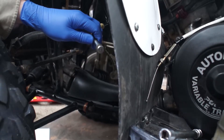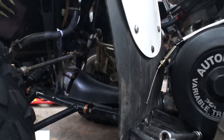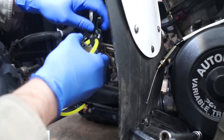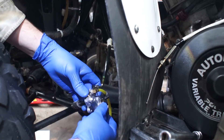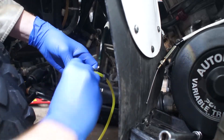I'll take the end of the oil line coming from the tank and connect it to the pump just above the tank level. That way when I remove the plug, oil won't leak out because it's higher than the oil tank. Then I open the bleeder screw so it fills up the pump.